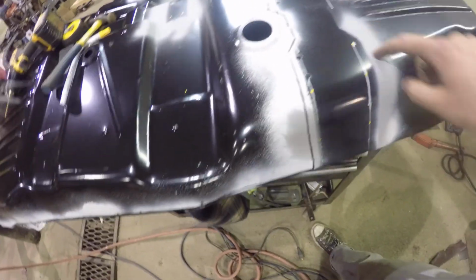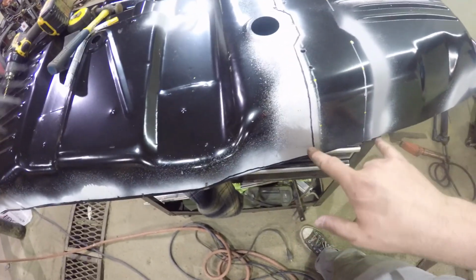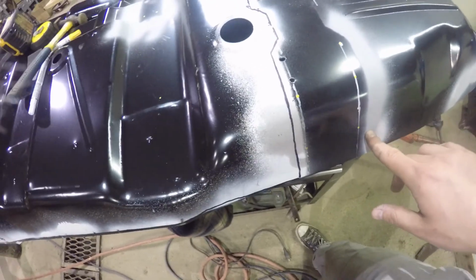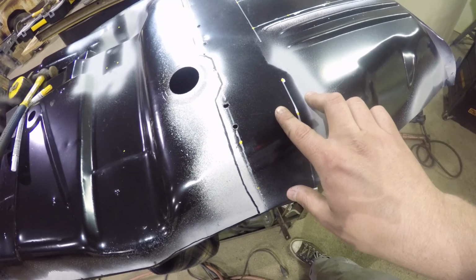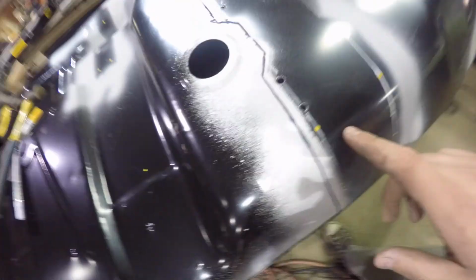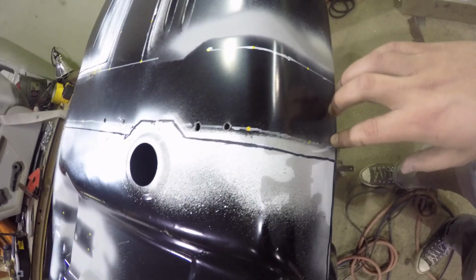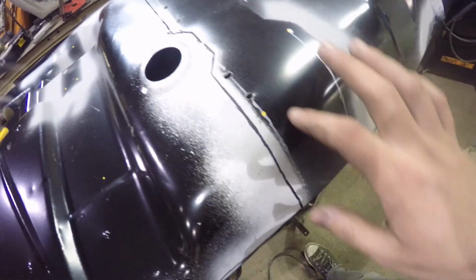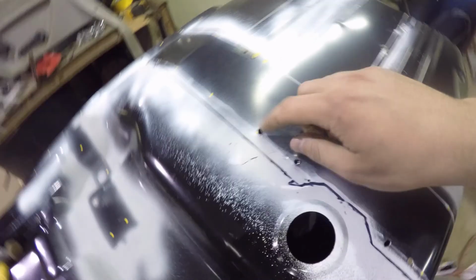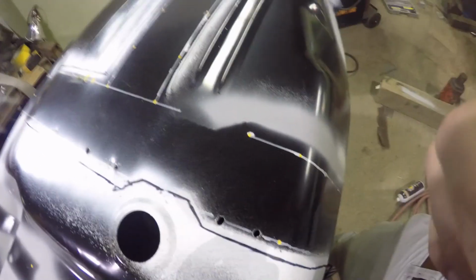So these are my spray paint lines. You have spray paint lines and then the marker line. Now if you have one side, technically mine are 4 inches, so I just measured over 4 and then half back, because roughly that little flange is about 1 inch. So everywhere there's white, that's the line of the actual half inch that I could use. Put a few dots, got a straight line, went straight across as much as I could. Now the yellow is where I want a spot weld, so that's where we're going to drill a hole. And we're going to do quite a few.